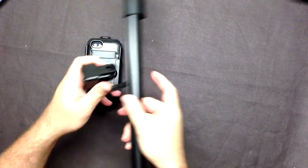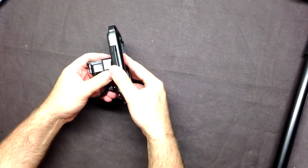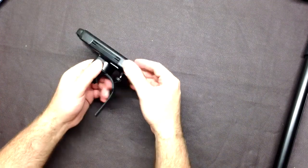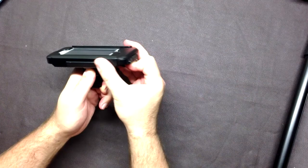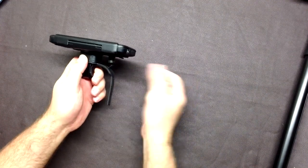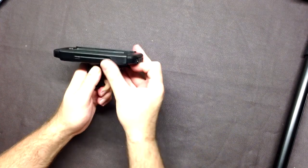Now after it's on your bike, this unit stays in place, and you have a quick mount for the case. They simply mate together and snap into place, and it's on there. Now it does have a double lock feature. By default, when it snaps into place, it catches a little tab, and all you have to do is pry this back a bit with your finger, and you can take it off the bike. Now if you want to really secure it, once you snap it into place, you just tighten down this little thumb screw, and it just takes about 3 turns, and it's absolutely on there, and even if you pry this off, it can't go anywhere. Then you just have to unscrew it to then take it off again.